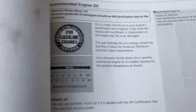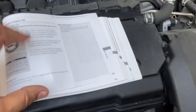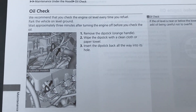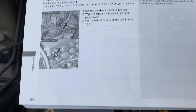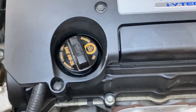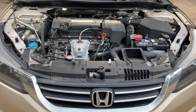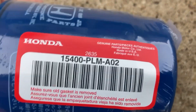Premium grade oil for gasoline engines. It also shows the method on how to check the oil level on the next page. So 0W20 is the oil that this Accord needs. The engine oil I'll use today is Mobil 1 Extended Performance. And that's the Honda oil filter with the part number on it. I'm changing the filter and the crush washer.